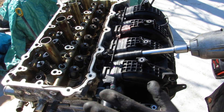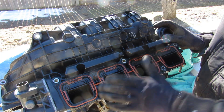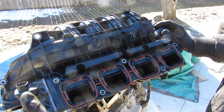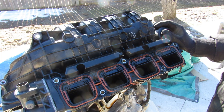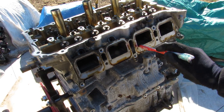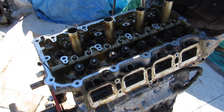I'll remove the 12mm bolts that hold this air intake on and pop it off. On the back of the intake you can see the four tumble flow valves that turn with the tumble flow actuator to create turbulent airflow depending on engine temperature. It's a pretty cool design — they went with a square intake port here. The head bolts on these are T-55 Torx.